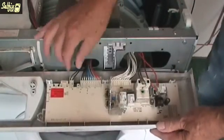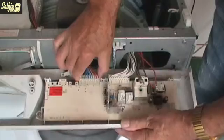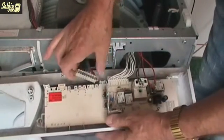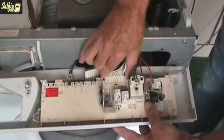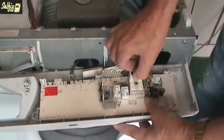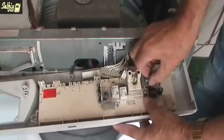At this point it would be a good idea to take a photo of the terminal blocks for when it comes to replacing them. Now remove them one by one and don't pull on the wires. Ease the terminal blocks away from the module. If you have to touch the module then do so by holding the edges. Don't pull on the wiring alone but grip the connectors and ease the terminals apart. This way you will have less possibility of snapping the wires or damaging the module.